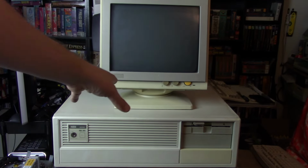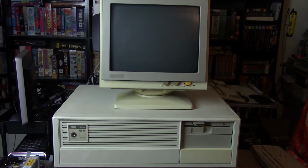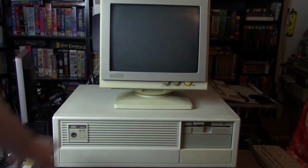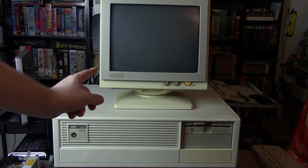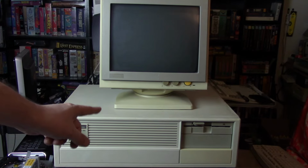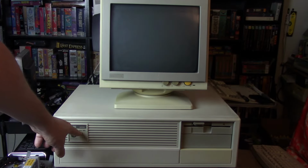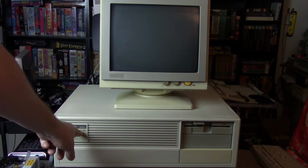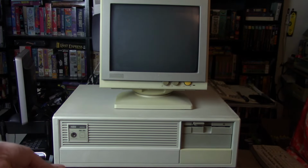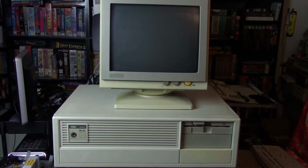And the power supply seems good. The board should fit in. I should be able to just pull that board out and put in another one. So I can technically turn this thing into a 386 of about the same era, actually. I think the CPU in that board I have is a 20 megahertz 386DX, and the 10 megahertz display kind of throws it off, but I think when you turbo that board, it clocks down to 10 megahertz, so this could technically function as a turbo indicator when it's in the slower, low speed mode. You can make it make sense that way, if the 10 megahertz display mismatched with the CPU bothers you.